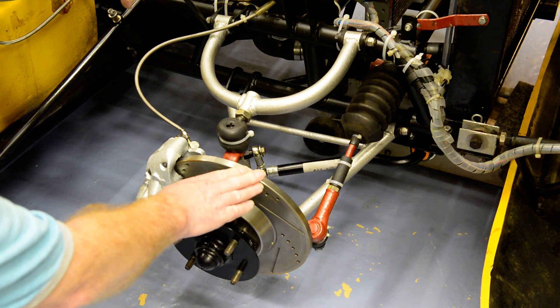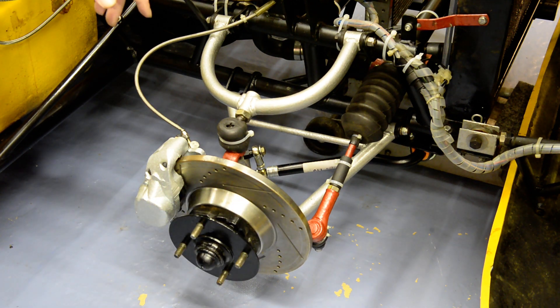You'll notice the brake discs are non-standard. They are the same physical size but they've been cross-drilled and grooved just to improve their braking ability. The discs are quite good for this car in terms of weight — the overall dry weight of a Series 3 Vixen is around 800kg, and the stopping power of the 10.5-inch front disc is not too bad for that weight of car.